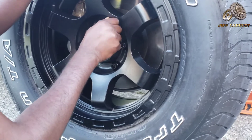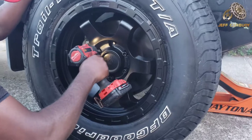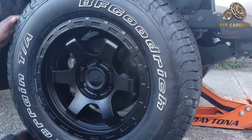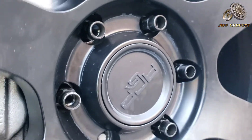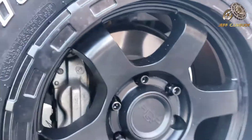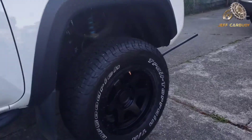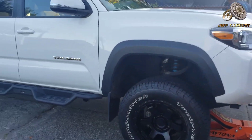When installing the wheel lug nuts, it's always a good idea to hand-tighten before you come in with the impact tools. Hand-tighten them, and then once they're hand-tight enough, rotate and impact the one lug nut that is missing — that's going to be the lock, and it's a special lug nut which I'm still waiting to arrive.